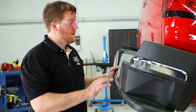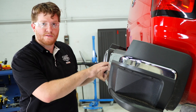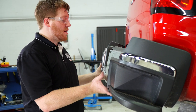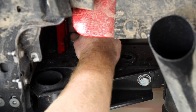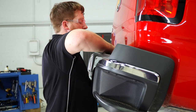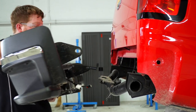Now we're going to remove the last bolt on the passenger side, but we're going to leave it loosely in at the very end to help support it as we take off the bumper. So with that one bolt loosely in, we have that and the crossmember that the bumper is resting on to secure our bumper. So we're going to go ahead and hold onto it at the center, reach up and take out that side bolt, and with that bolt out, we'll hold it at the center and remove our bumper and set it aside.